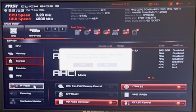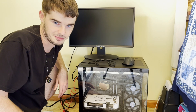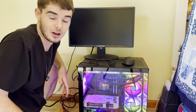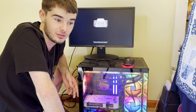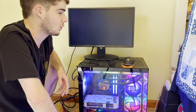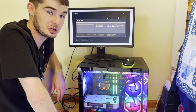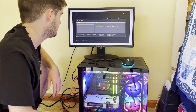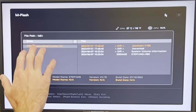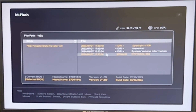This is very important. If you have animals, remove them from your room right now. If you have unstable power in your house, consider buying a UPS — that way if your power cuts off, you don't have to worry about critical issues. Your PC could literally become an expensive paperweight if you were to lose power or turn off the PC during the BIOS update. We can see our Kingston DataTraveler 3.0 drive here.